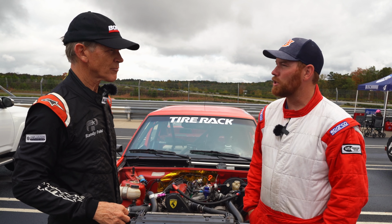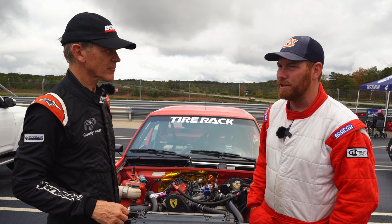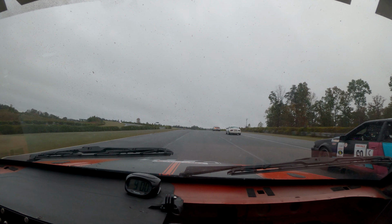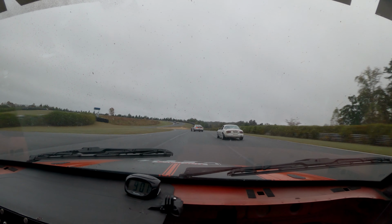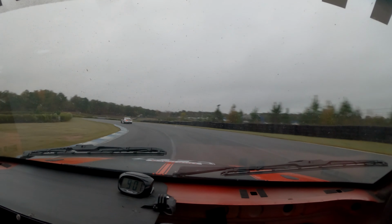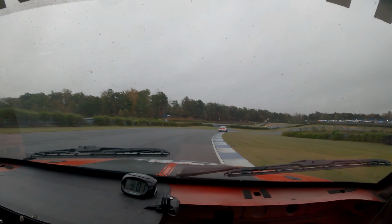Well, we made some changes. We put the right combination of parts. It's got a Tilton master cylinder and throw-out bearing, and somehow we ended up with the wrong combination of parts there, but Tilton set us straight, got the right master cylinder on there. And you know Frank Resinetti, the guy who's done a lot of the major rework on the whole car. He himself chose to put a real live race clutch in this car. I thought he was nuts. But I'm like, well, if you want to buy it, go ahead. Well, we've actually had a lot of trouble with it. Sam's work on the hydraulics was a big step. He put a smaller master on there, and made the pedal lighter and gave it a wider range of engagement. It just feels a lot better.